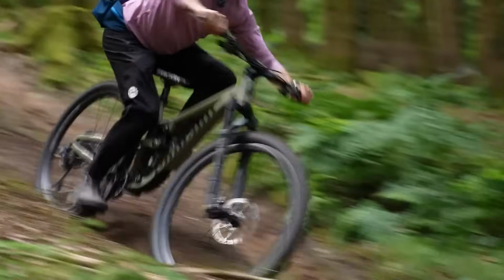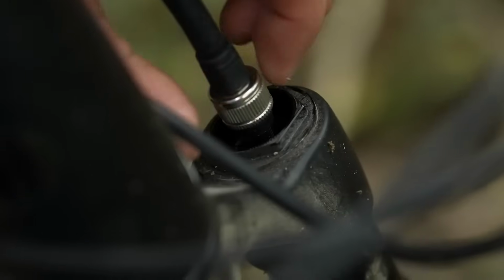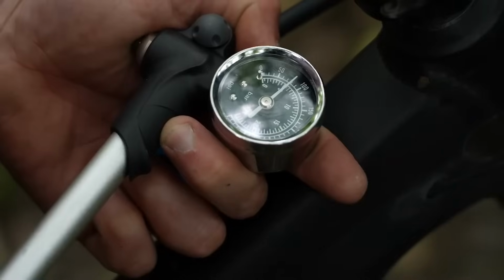But when you look at the suspension stuff specifically, a lot of similarities come out in terms of silhouette. They're not using any kind of wild linkage fork like Trust or anything like that. Pretty much air, oil, regular kind of round. They're not inverted or anything like that, not an upside down fork, although both I think have tried them in prototype form. And how you set them up is pretty simple as well. You just stick a shock pump on them and play with the sag.